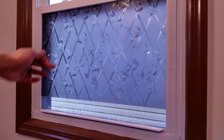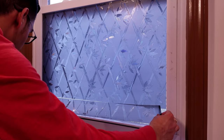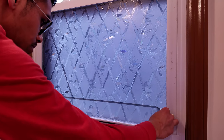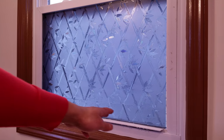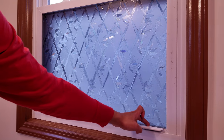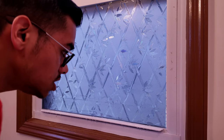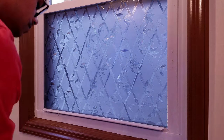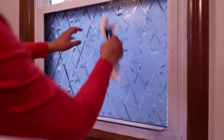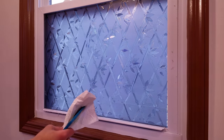Now that we have the top portion installed, let's go ahead and install that little slice for the bottom. I cut this so that it will line up with the top portion — just make sure that both pieces line up so it looks nice. There's a little piece of extra film hanging off the bottom, so just give that a trim. Once you're finished, grab a paper towel and soak up the extra solution. If you still see some air bubbles, put the paper towel over the squeegee and give it a nice press and pull.